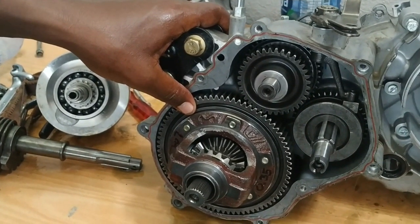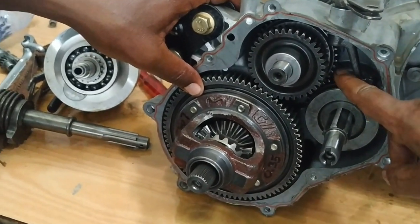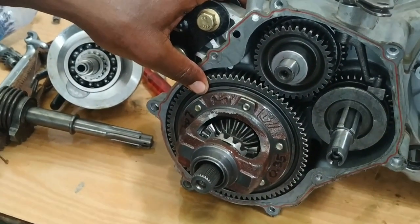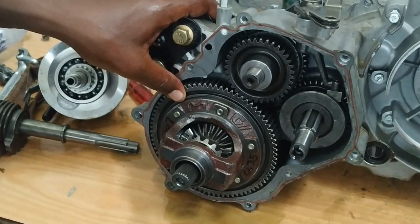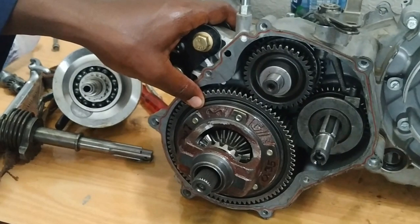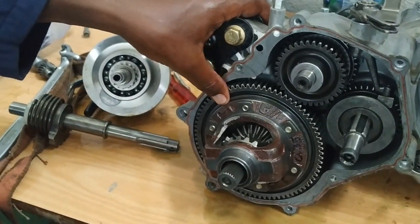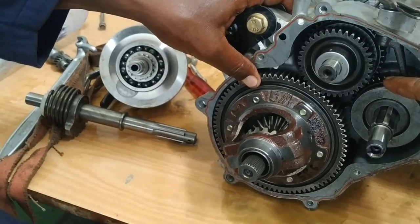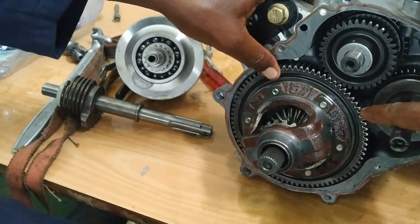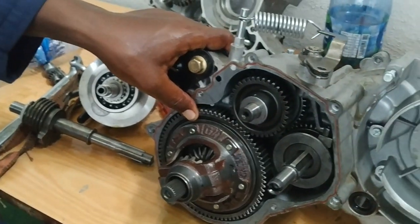There is a slight variation from that of a regular vehicle when this idler gear is involved — we are selecting the forward speeds. Now let's see what happens when reverse is selected. When it is turning in one direction, then when you move this gear and engage it directly to the ring gear, the direction changes. Let's see how that is done.